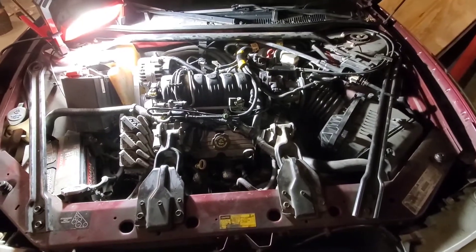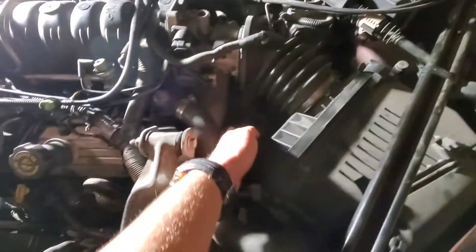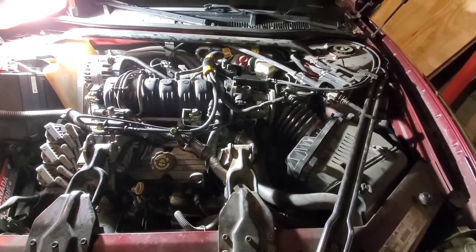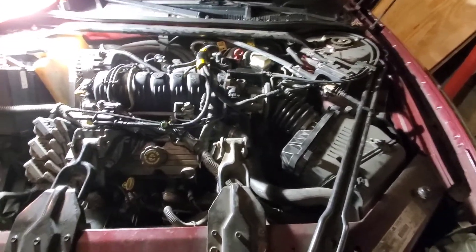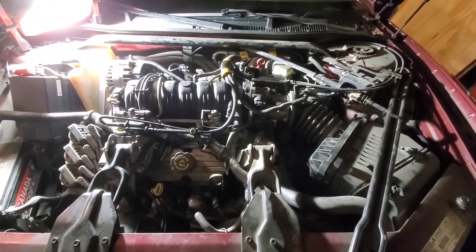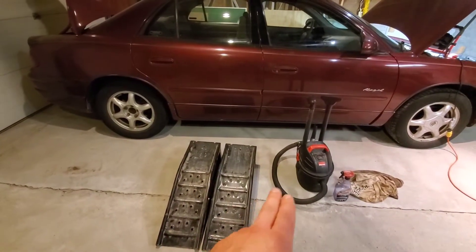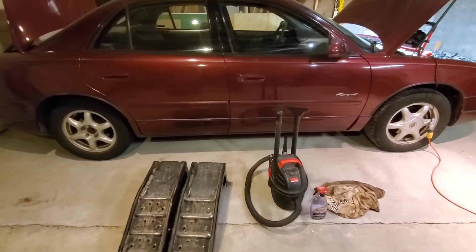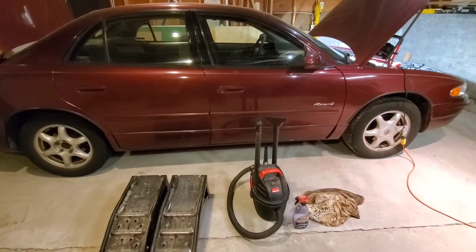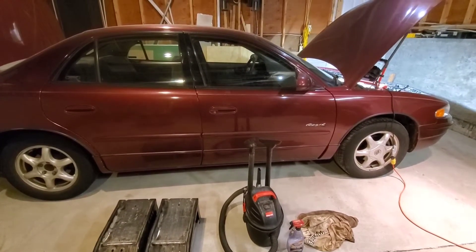It wasn't the oxygen sensor, so I'm going to move on to testing the exhaust. The exhaust runs down here, then here, and back behind the car. What I'm going to do is take a shop vac, blow air into the system, and then with soapy water spray everywhere and see where we get bubbles — basically the same technique as testing for a gas leak. The tool list: a couple of ramps, a shop vac, a spray bottle, and a couple of rags to plug the other exhaust pipe.